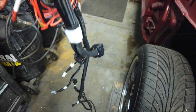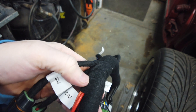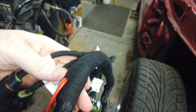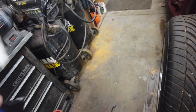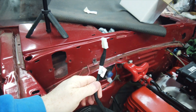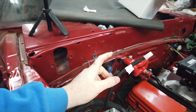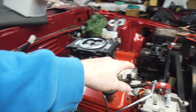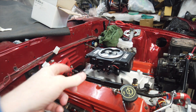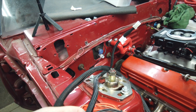Here's where you hook up to the ECU and where the power goes. I tried to see if I could unwrap this, but the power wires loop right back down — they're not giving me any extra length. These harnesses were definitely made for small block Chevys and they just use the same harness for everybody — that's why that wire is short and routes to the back of the engine. I'll go check the distributor downstairs to see how long that cord is, but the coil wire length could be fixed by splicing in more wire.